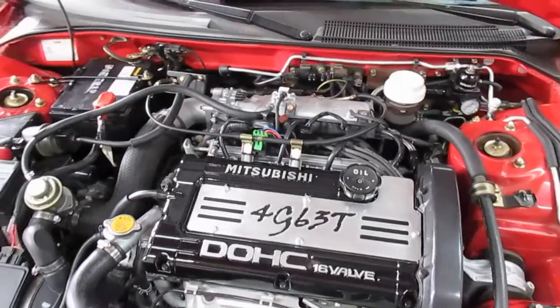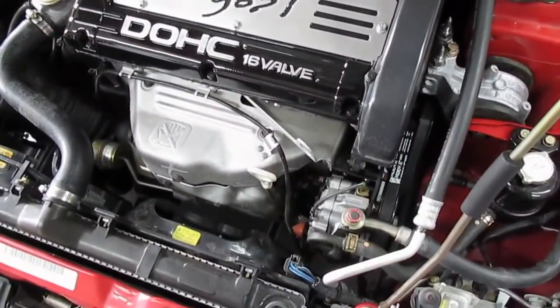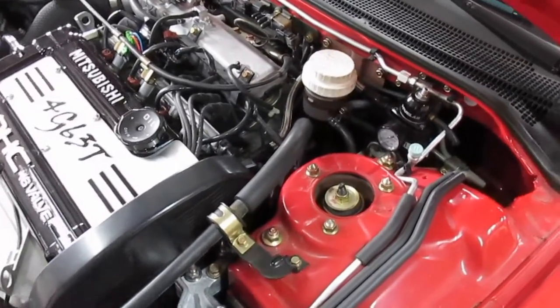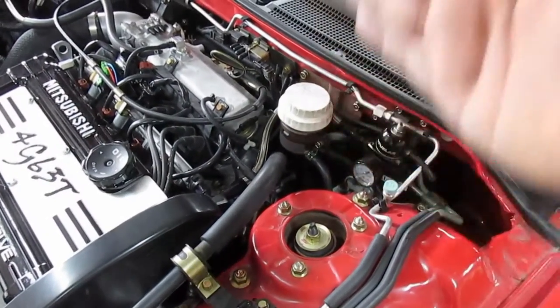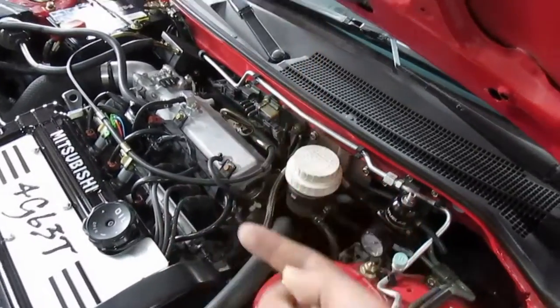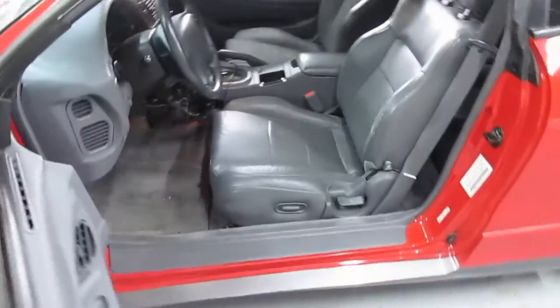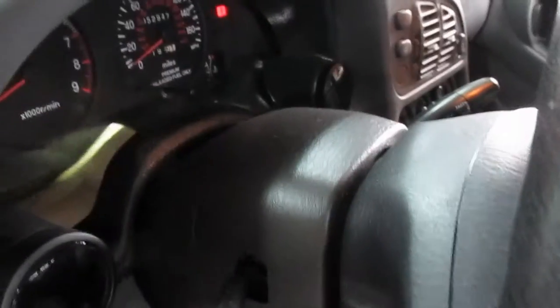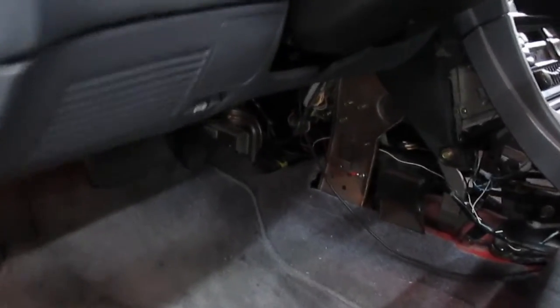In this video I'm going to show you how to hook up your Innovate wideband to your ECU so that you can get better tuning. The wideband is back here, right behind the oil pan, pointed straight up — in between the crossmember at the firewall and the oil pan. The wires come up and go through a grommet in the firewall. I already have it wired up. I have one of these gauge pod setups, so the wideband is on that side with a boost gauge. The signal wire is already running down here near the ECU.